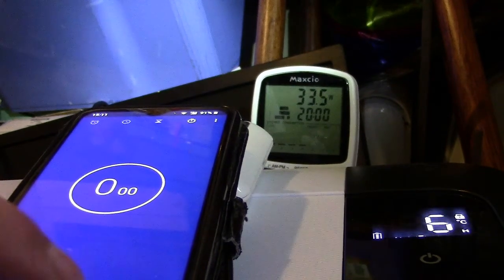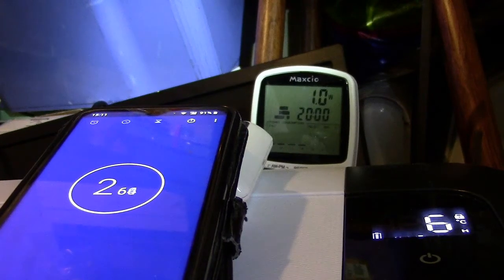It's just switched off — there we go. I've started the timer. Now you can watch how long it takes to get back up to eight degrees — that'll give you some idea of how well insulated it is. Then you can time how long it takes to get back down to six degrees, which will give you some idea of how efficient the pump and cooling system is.